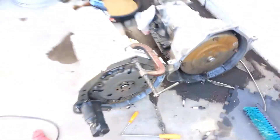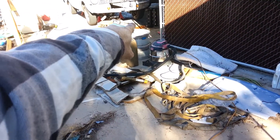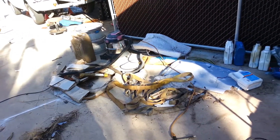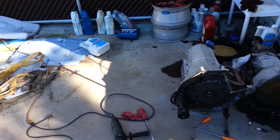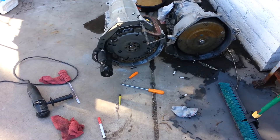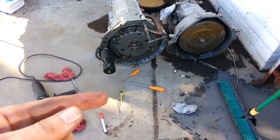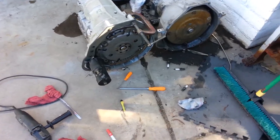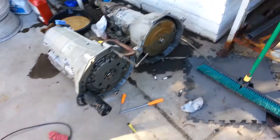This is one of those things — I might have to mock it up. I might have to put a crank in that block over there and then just clamp journal three and five together to keep the crank from wobbling around too much, then bolt the flex plate to it, and kind of smash all the pieces together to see what happens.